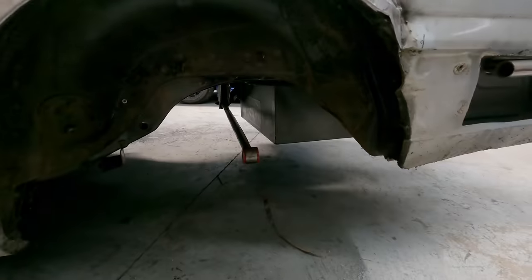We've got no diff — she's gone. Back at the diff shop, they've heated it up and bent it, so we're putting in a little camber and a little toe in, and chamfering the splines and axles to get a bit more drive out of it. The thing's got grip but it's got a thousand newton metres of torque. Dropping the pickup points on the diff for the arms and changing the arm bearings to polyurethane instead of a spherical bearing to get a bit more wriggle — trying to get this thing to put that tire on the asphalt.